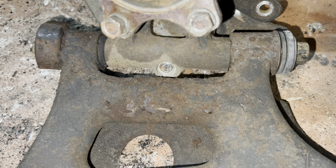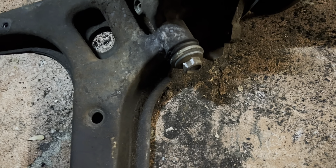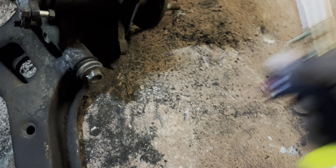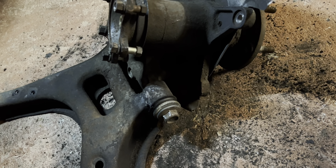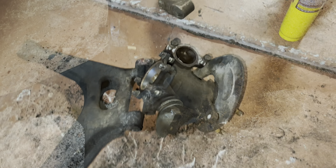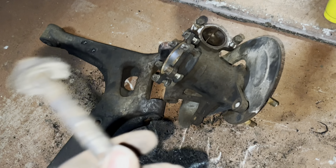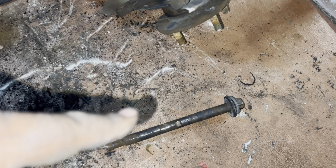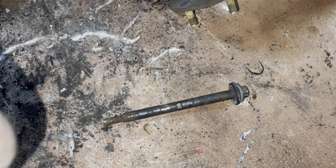With the help of the pry bar, we got it to a plateau where we can kick it loose. Hopefully she'll come out now since she's all loose, thanks to the torch. Let's see if she'll come out — a little bit of hammering should shoot it out technically, but we'll see. After that, hopefully you'll have success. This is still a little hot, but have a little success. Try not to destroy this bolt — this one is not one that is easily replaceable.